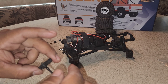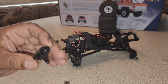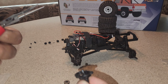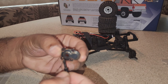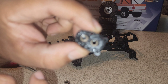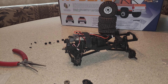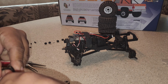Let's see what we have to do here — we need to remove the gear. There is a cross pin right there, so let's not lose that. This pulls out just like that. I can see the portals actually have bushings, so we're gonna have to upgrade those later. I'll just make a note here to take those bushings out so we can transfer them to the new cover.